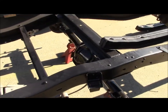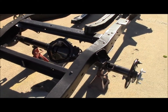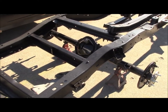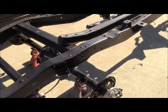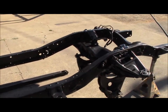His differential — we rebuilt it all. He's got 3.07 gears in the back. That's a good gear for him. He wants to take some trips with his wife, cruise around town, and it'll be good for gas mileage and all that. He'll still be able to light the tires up off the line — he's putting a 400-horse 350 motor in it. That's what we got all done up for him.